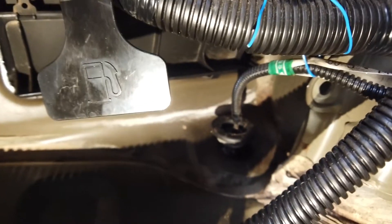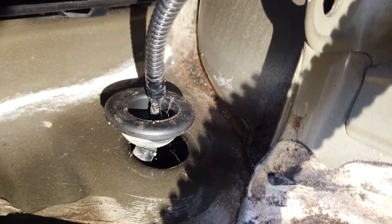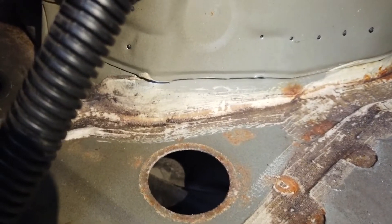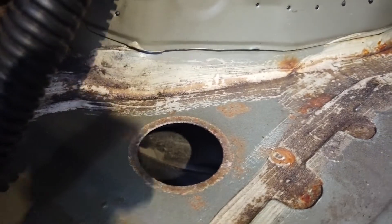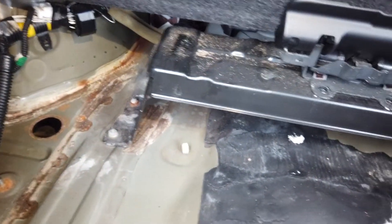Look over here, there's a grommet — you can see the hole there and the grommet. Now that grommet I've lifted up, removed it from the body, lifted it up, and tied it up with wire — that basically keeps the whole thing up in the air, and as a result any water that comes in will go straight out of there. No joke, that was a proper puddle. Same over here — there was a grommet there and I've just pushed it through because it was not doing its job. Water wasn't going through, it was just piling up on top.